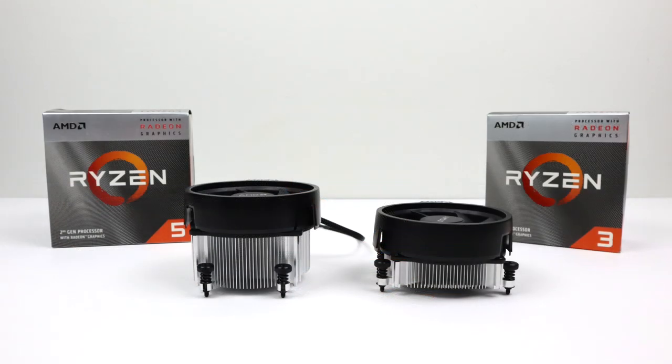When I was originally planning this build I was actually going to go with the Ryzen 5 3400G, which is a little bit of an upgrade over the 3200G, but it would have upped the cost significantly — it's $50 more, plus it comes with a taller cooler so I would have had to buy an aftermarket cooler. I did test it out and even with an aftermarket cooler and an extra fan I was still running really hot. So I decided to go with the 3200G and it actually does a really good job. I'll leave a link to the 3400G full review in the description.